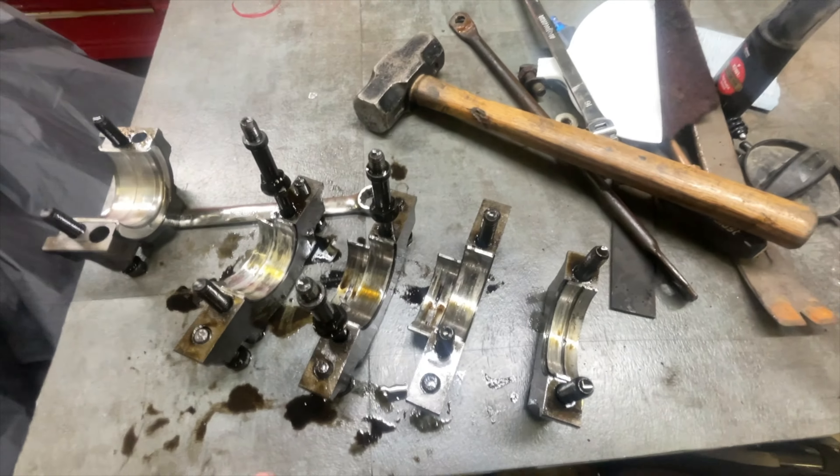I probably have more of a chance of an issue replacing them than leaving them as-is, worn in and mated to the way they should be. The crankshaft where the main bearings all ride is actually fairly decent. This one has a little small bit of damage - I'm going to take a little piece of emery cloth and clean this up. This is basically the aluminum bearing that's connected to the main bearing here. I'm going to put some new bearings in, just regular OE size, which I'm going to verify - that this was an original bearing and it hasn't been rebuilt. There will be some markings on the edge that will indicate it's not an oversized bearing. You can see the bearing where it started to melt right off the side - that was the pieces we saw down in the oil pan.